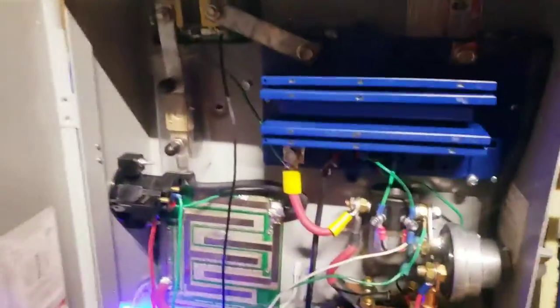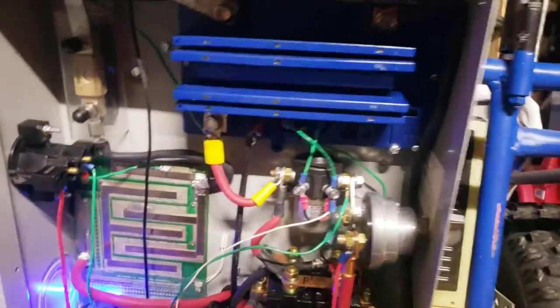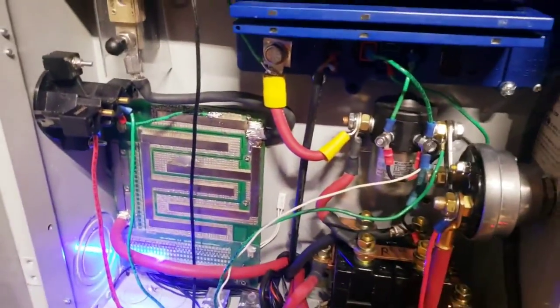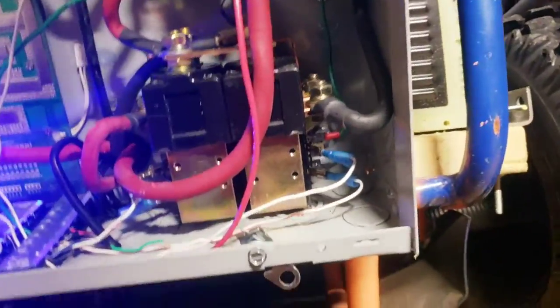This is after I've assembled the go-kart conversion unit. As you can see, I've been charging it for a little while — that charger puts out 50.2 or 50.4V at full charge. The BMS unit is notifying me via those little LEDs down there; there are 12 of them indicating the battery is up to full charge. This is just topping it off.